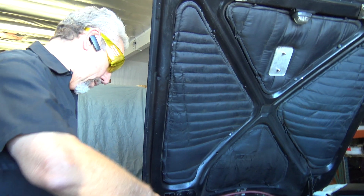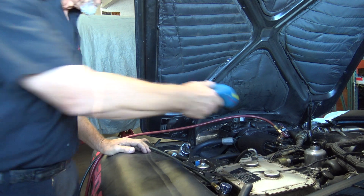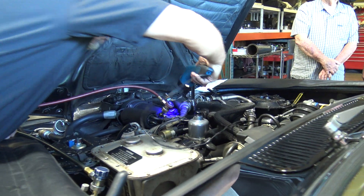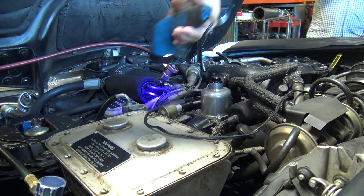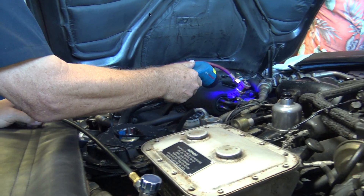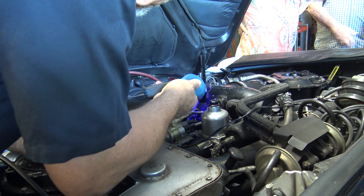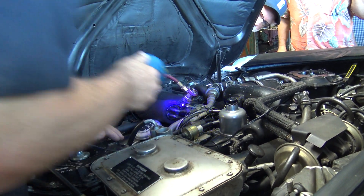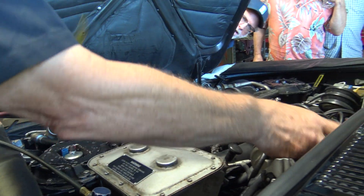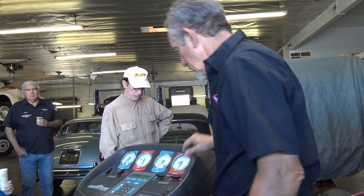This is an ultraviolet light — you do not want to look into it, it's not good for your eyes. I'm going to let people try these on and see what it looks like. I'm going to take a quick look and see if I can see green. Hopefully we put dye in it — we typically do when we do air conditioning work. If not, I'll charge it up with dye and see if we can find some leaks. Once I see a smoking gun I'll let you guys look. It will show up as bright fluorescent green. What we'll do now is put a vacuum on this, charge it up, and add oil with the 134 — that green oil over here.